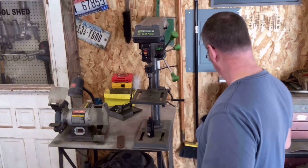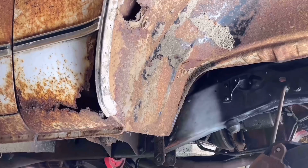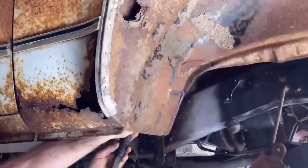That bushing's still in really good shape. And just to save time, make it easy on myself, I'm just drilling the 7/16 hole for that one. The bottom one will be 9/16 to accommodate the actual hole in the eye of the spring. Now all I gotta do is cut it in half and make 2 more. Yeah, I cheated.